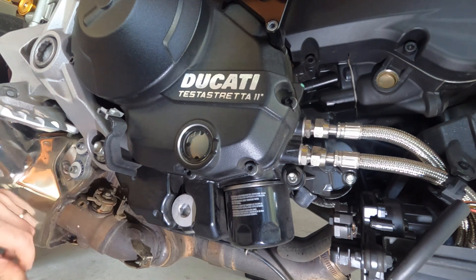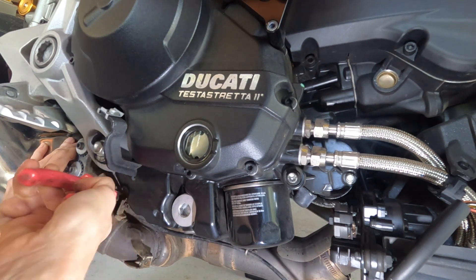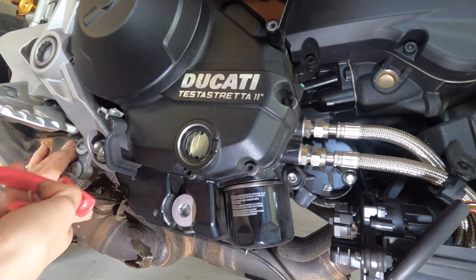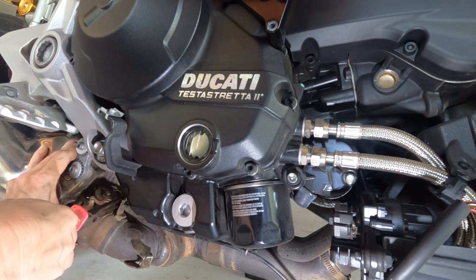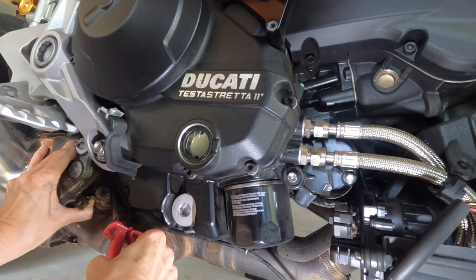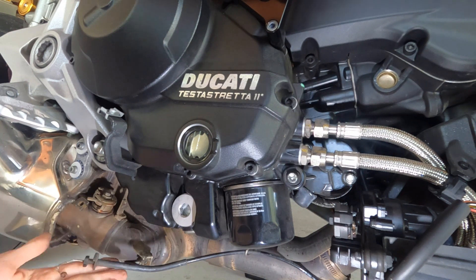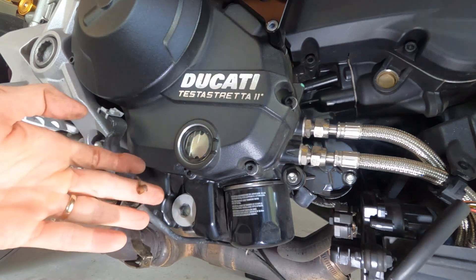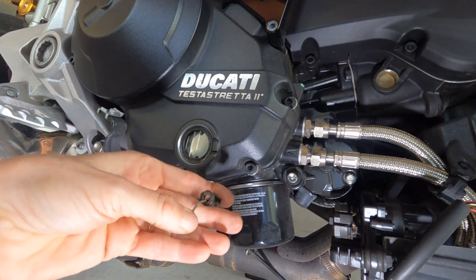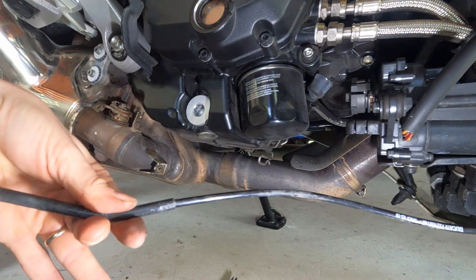I can see how I've got to release this cable — it's just a little bit fiddly doing it. I'm trying to pull enough through so that I can ease it around the outside of that little valve, around the top of that spring, and then just lift the barrel head out of it. The condition at this end looks quite a bit worse — something rusty on that little barrel head. I've just mutilated the cable there, so that bending is my fault. There we go — didn't need any tool anyway. So cable's out and that will go in the trash.